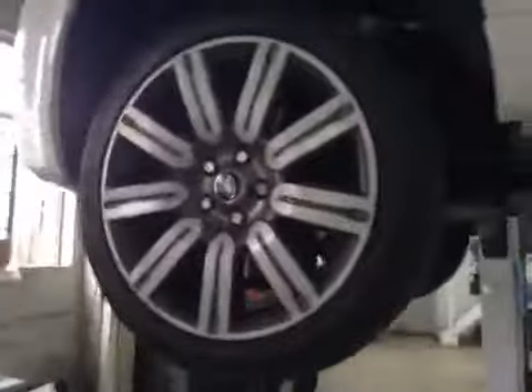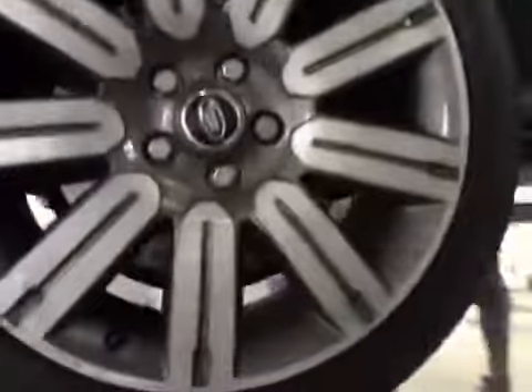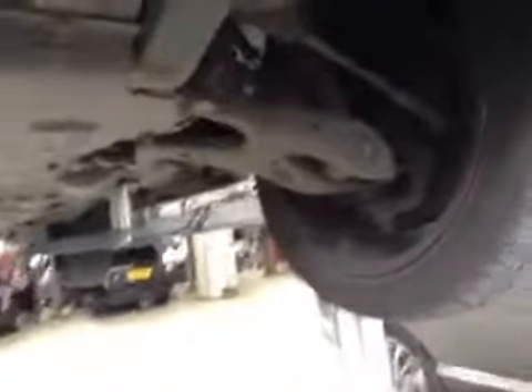All trims and mouldings on this side of the vehicle are in good condition. Coming to your nearside front tire, tire depth is all in green. Front discs and pads are in green, with front pads at approximately 7, 4, and 8mm. All suspension components on the front of the vehicle are in good order, with no play at the front wheels. The gaiter is free of any splits and brake lines are free of damage.